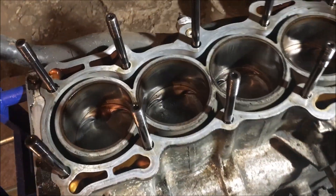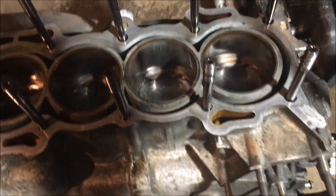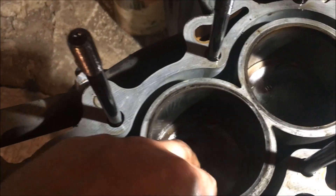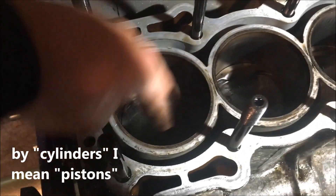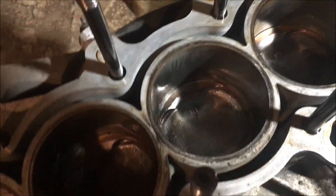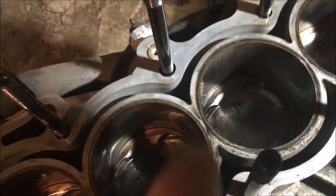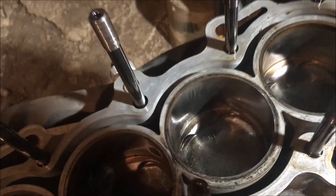At first I wasn't sure, but now I am sure the problem was in the block. If we look at cylinder number two, there are gaps, and I was able to push it down slightly — so it's loose. All the other cylinders don't do that: nice and tight, no problem. But cylinder two was loose, and you can even see one of those gaps right there — that is not supposed to be there. This thing must have been burning crazy oil towards the end. You can even see some scraping along the side here. So this is our problem; it's below it.